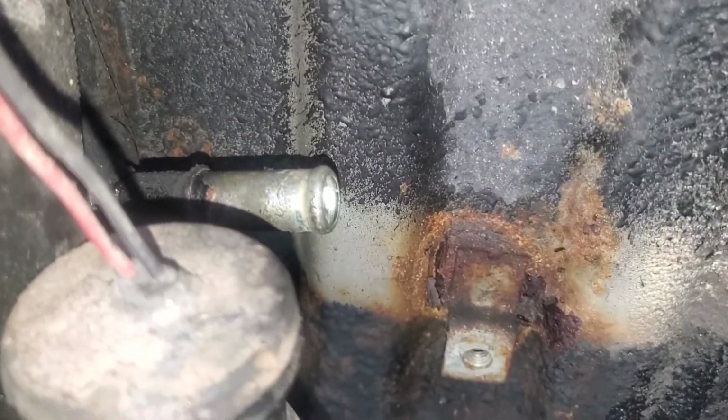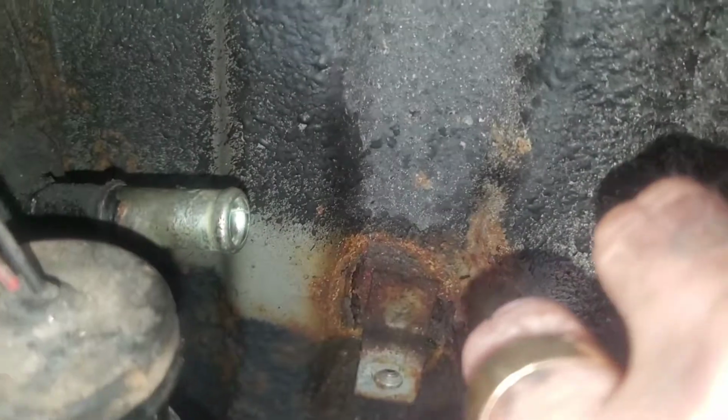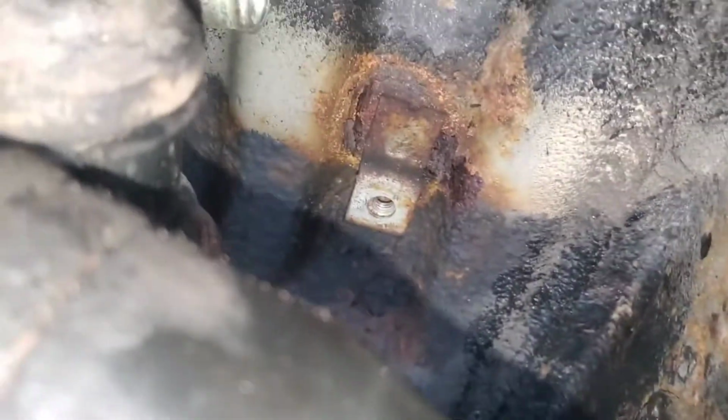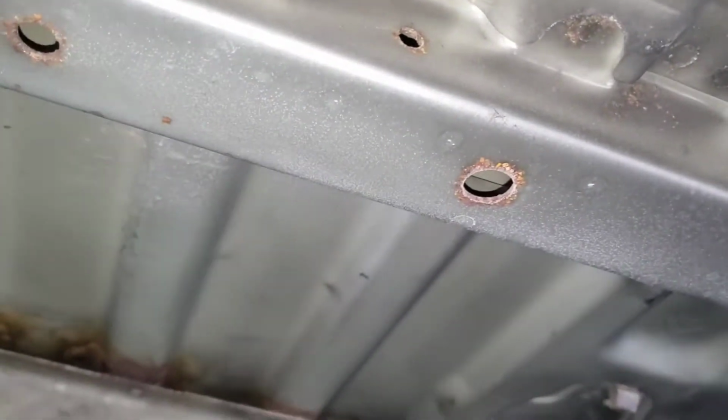This pipe here, I could not get it off. It would not come off while the tank was in place, so as I dropped the tank, I slid that off the tank end. And the air one up there goes through a hole in the chassis here and out the other side and onto the tank. You disconnect it at that end and slide it through the hole as you drop the tank, leave it attached to the tank. And the electrics, once it's dropped down, it's just a plug.